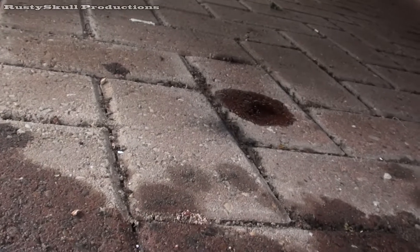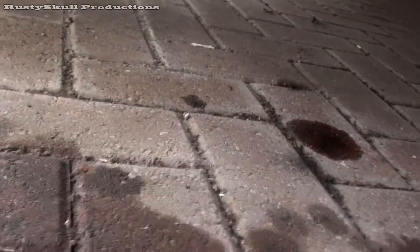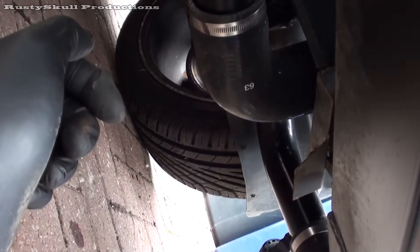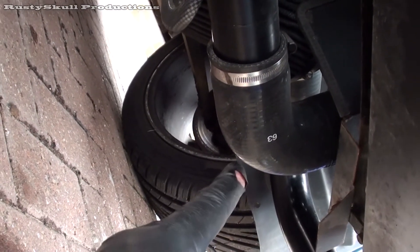Oh look, we've got another leak that's appeared in the last half an hour. Power steering fluid is everywhere — that'll be power steering fluid. I've got to try and locate now which one it is that's leaking. That's been rubbing against something — it's rubbed pretty well. Maybe the leak's on this side. There's a very certain boost leak somewhere. That one had a hole in it — oh, is that the one I taped up with tape? I think I might replace all these clips with proper boost clamp clips instead of Jubilee clips while I've got the bumper off.